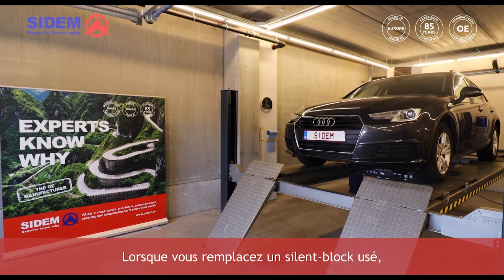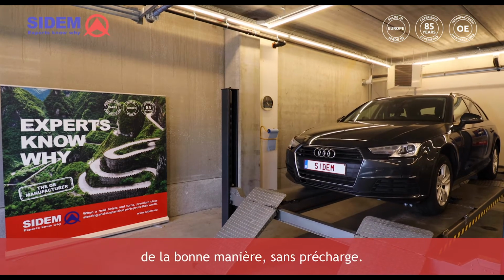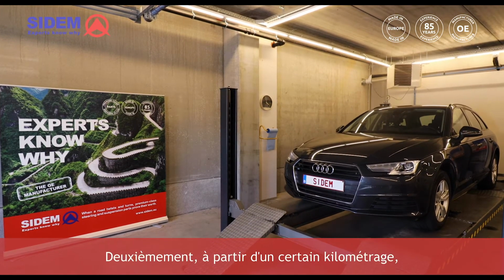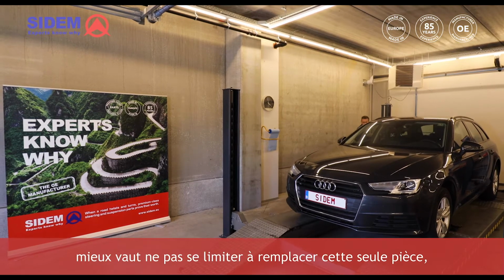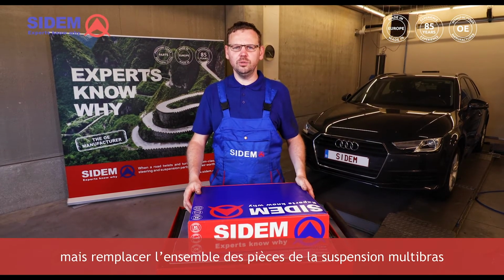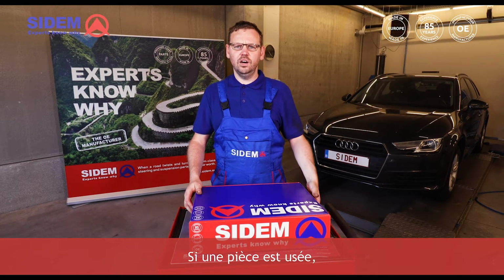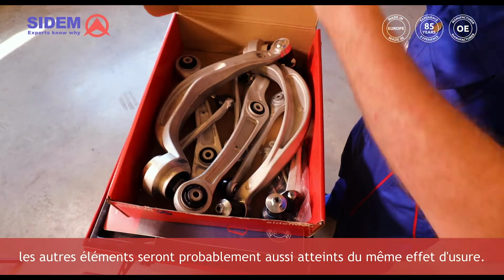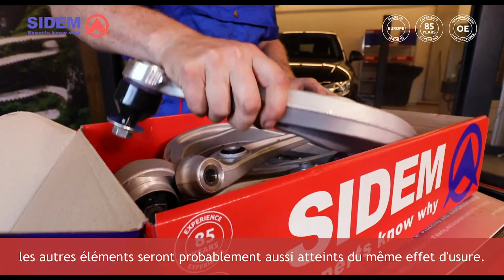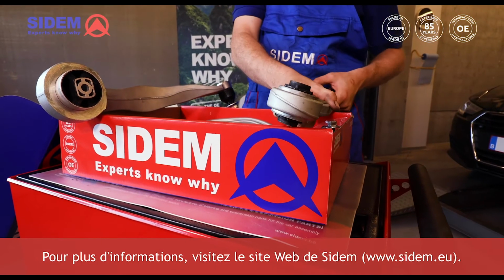Important to know when you replace a worn out silent block is firstly to install the new part in the correct way without preload. And secondly, starting from a certain mileage, it's better not only to replace this part, but also to replace all of the items in the multi-link suspension with a new kit. Seeing one part is worn out, the rest of the items will most likely also have had the same effect of wear and tear.